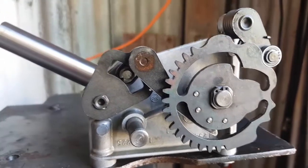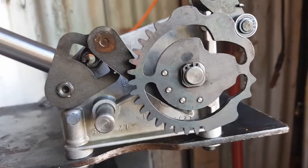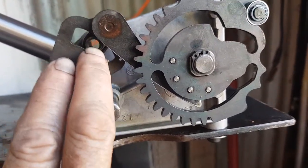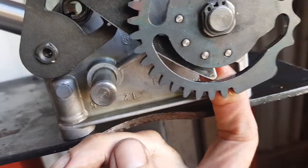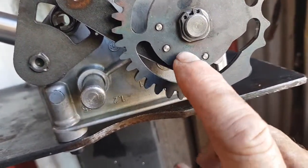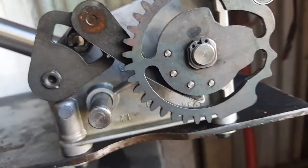This is a shift cassette. This tube here at the back is sitting on the gear shift lever, which would normally be on the outside of the gearbox where your gear shift pedal would be, or the remote linkage if you're on one of the later bikes. It comes through into this little quadrant here and bolts onto the back of that. This is where the infamous spring lives. This is the shift pawl — it goes up onto a set of pins which you can see on the back of this big shift wheel. This is the little shift roller that keeps tension on the wheel.